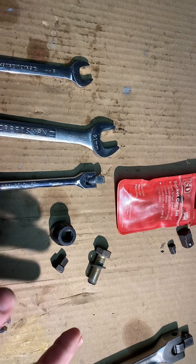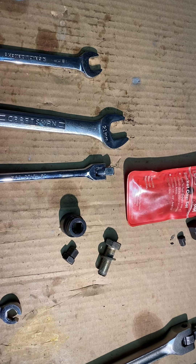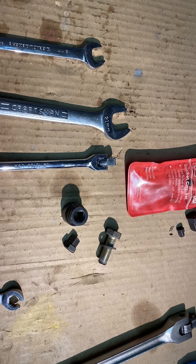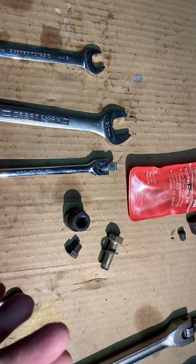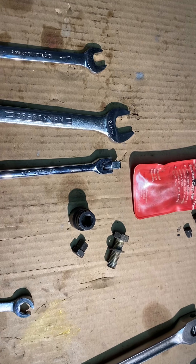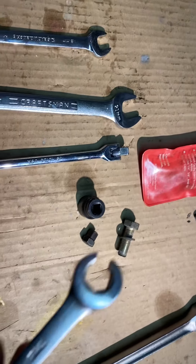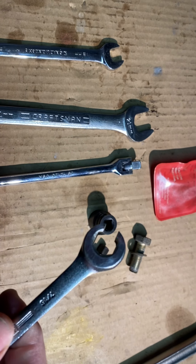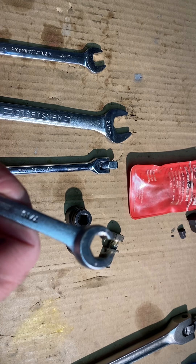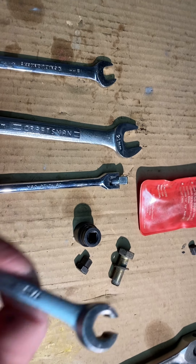The bottom one, you can't get from the bottom, you can't get from the top with a breaker bar. So what I try to do is first remove the brake line, which is in the way. If you can get the brake line off, then you can get a wrench and swing it in there. But you're not gonna get your 11-millimeter or 7/16 wrench in there to turn it — you cannot get it in there to unwind it, it's just not happening. It's just very bizarre.